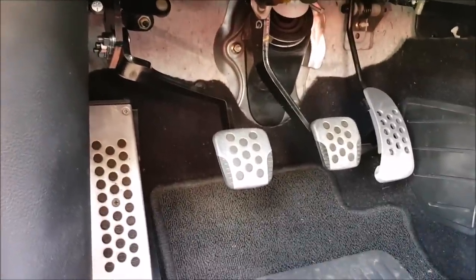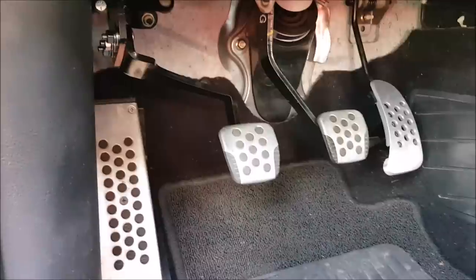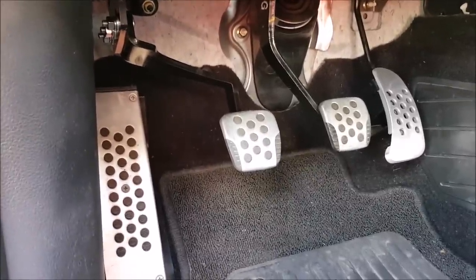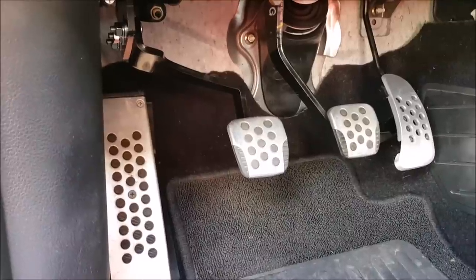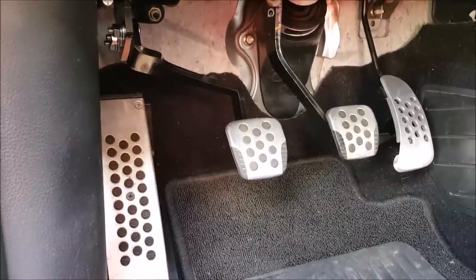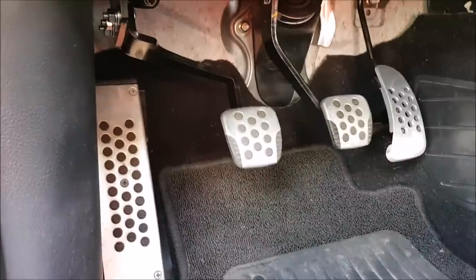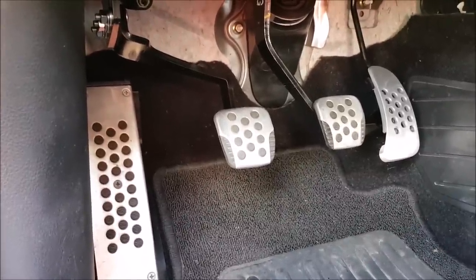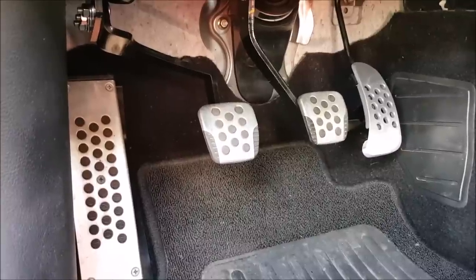But what you're going to find is, no matter what you do — whether you put .4 in, .5 in, or .3 in because that's what the system's designed for — some of you have changed out the master and the slave and gotten a good pedal. But why is that master and slave leaking internally? These cars are around 10 years old at the time of this video. You shouldn't be having that issue; these cars are still too young.